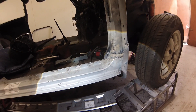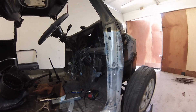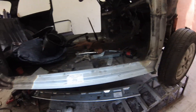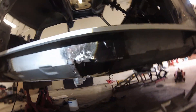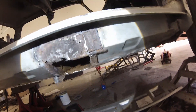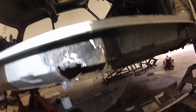I want to make a solid rolling Mini for now — this is what we've done. I also billy-bodged this piece because it wasn't big enough if you remember, and the inside of the door area actually looked really good once it's going back in. It's rock solid — moves the whole car when I grab it — so that's a good sign. This side still needs spot welding underneath same as the other side. I also need to cut out the rest of the rust inside, build it back up, and put a jacking point on this side because it's missing. Then pour some rust treatment inside because the floor is starting to rust on the inside — not much I can do about that without changing the entire floor, which is planned for the future.